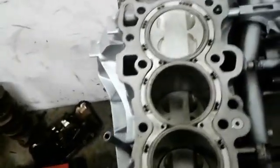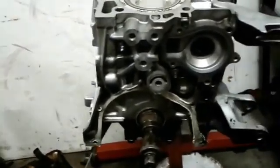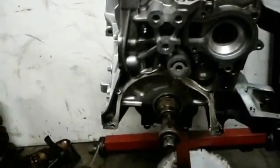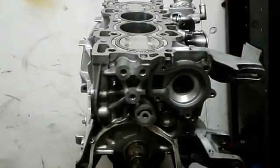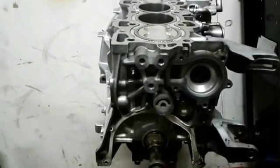This thing is finally finished — and by finished I mean pistons and rods are in. It's still got quite a bit of work left. Final thoughts on this side: it's spinning a little rougher than normal — it takes a little more effort to rotate the crank, but it doesn't get stuck or anything; it's not scary rotation. The same thing happened with the B20V, and actually the B20V got stuck when I was spinning it and I freaked out a little, but now that motor's running and everything's fine. So some are just a little stiffer than others. I learned some tricks with that ring grinder — it does help a lot and it keeps all the cuts straight. Definitely worth buying.